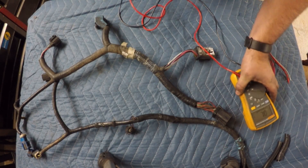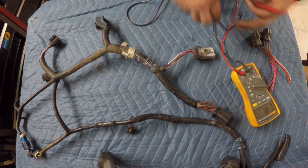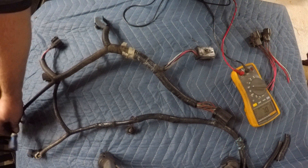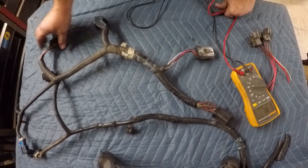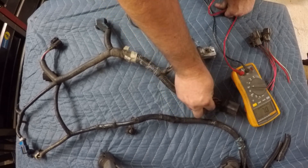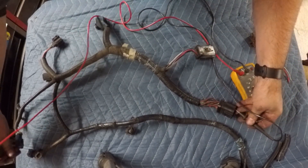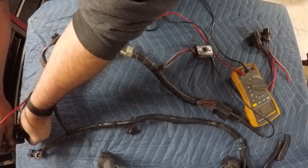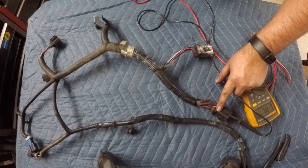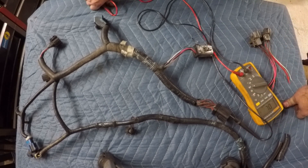Before I strip this out any further, I just wanted to point out something I noticed — a repeat wire color: a white wire with a black stripe appears between two plugs. The transmission range harness has one and the O2 sensor back here has one too. I needed to figure out which was which. I thought the one for the transmission range sensor would go through here since it seemed transmission-control related, but when I checked it out, that wire actually goes back to the rear O2 sensor. So I'll have to use this plug as part of the adapter harness as well. This is why it helps to have a meter to verify all your wiring, not just rely on wire colors.